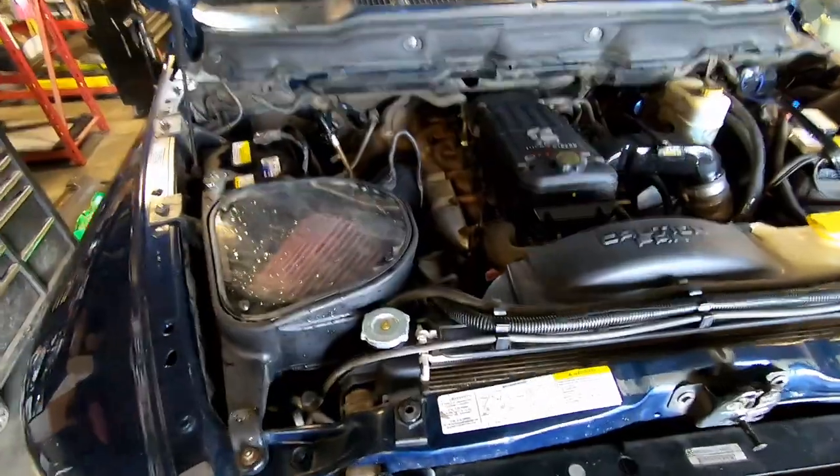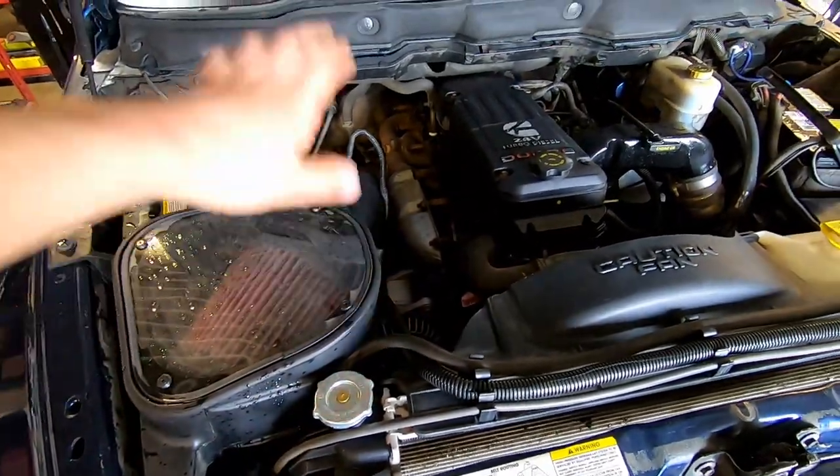I already know I'm going to be getting some comments saying why are you putting a VGT turbo — fixed geometry turbos are way more reliable. Yeah, because a fixed geometry turbo doesn't have a turbo actuator, and that's usually the most common part that fails on a VGT. But with a VGT turbo, it's a big turbo that can act like a small turbo because it has vanes in it. So you get way less boost lag — it closes those vanes, builds boost real fast, then opens up as boost builds. You also get a built-in exhaust brake when you decelerate.